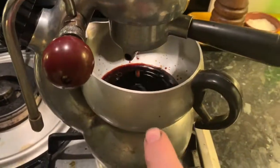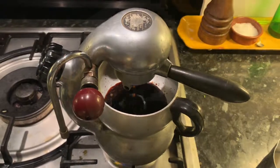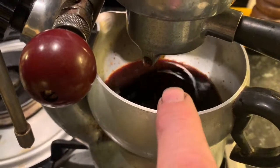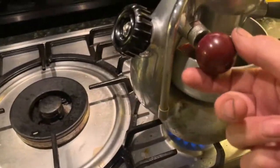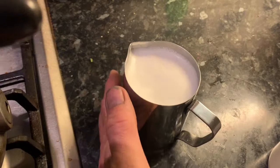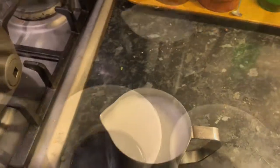There's a perfectly nice little rat's tail of coffee coming through, and no leaks from here or here anymore. We'll just see what kind of steam pressure we get from this machine. If your coffee starts changing and you get gurgling — no longer dark coffee coming out — just open the steamer quickly and let out any wet steam. When you're steaming using a jug, when the bottom gets just about too hot to touch is when your milk is ready. Don't over-boil the milk.